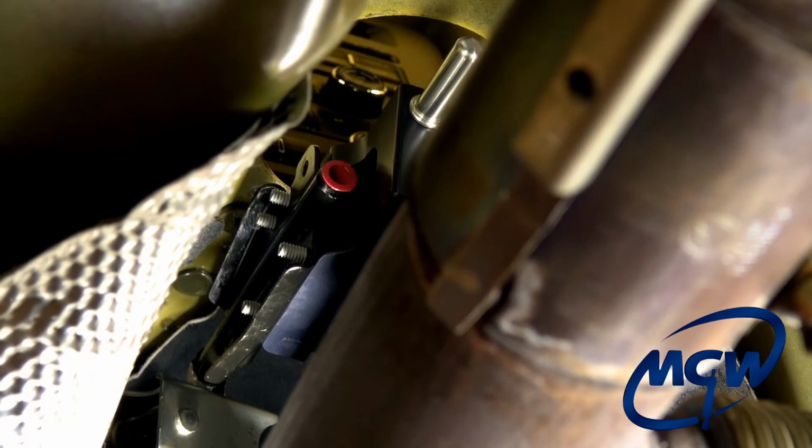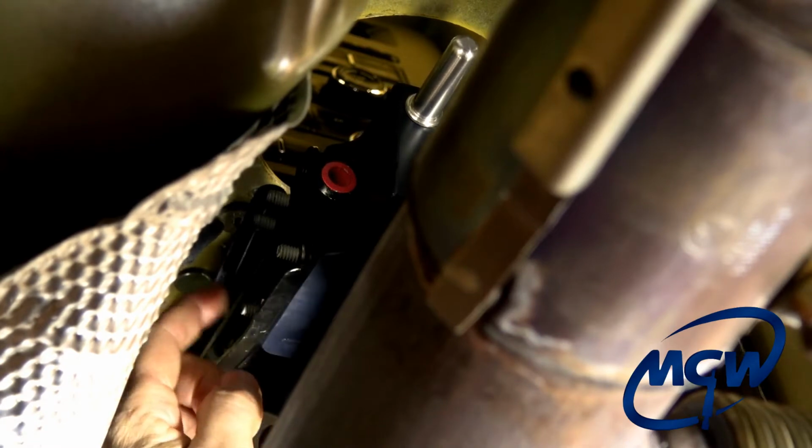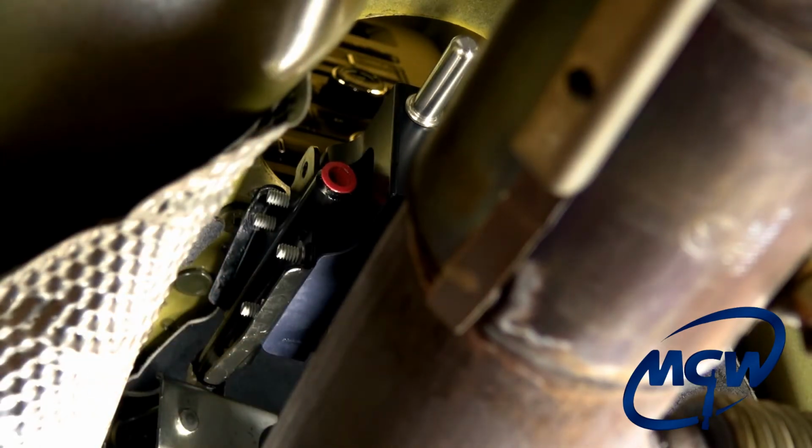Okay. Then we're going to take our four 1/4 inch split lock washers and put your right arm there and just hold it lightly just so it doesn't fall off the studs while you lay these lock washers in. To be honest with you, it's easiest to just do the bottom two first and get two of the nuts started. That way you know that box won't fall off the side swing arm. Once you get those two started, then you can grab the last two lock washers on first again.